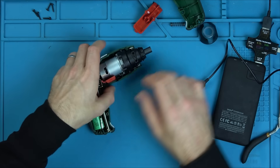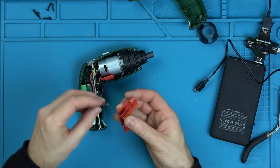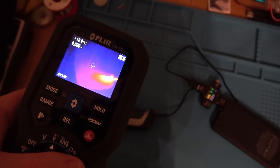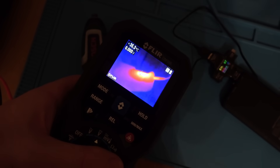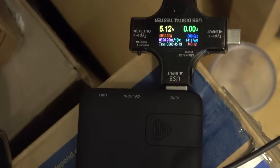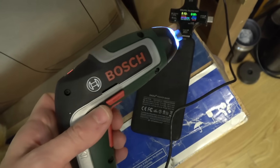Let's give this a good charge up and see if we can find something to screw. I put the trigger back in, the cover back on, dropped the screws, and charged it up. After about 20 minutes I notice a fair bit of heat, so I get my thermal cam out — it's okay, like 30-something degrees, just warm to the touch, and it feels like it's coming from the battery board rather than the battery itself. The good news is, the more it charges, the amps drop and drop. Eventually the amps show zero, meaning it's charged up and stopped charging when it reached the right level. Then I unplug it, plug it back in — it goes up to 0.2 of an amp, and sure enough 5 to 10 minutes later it goes back to zero. So it's definitely cutting the charge off. This looks like it's fixed.